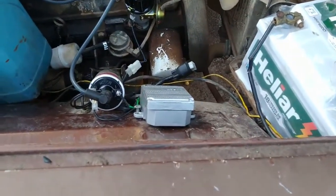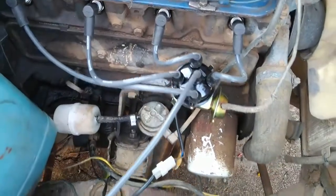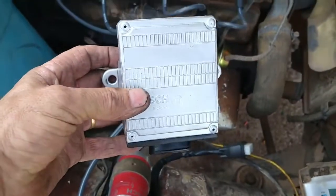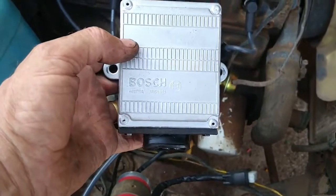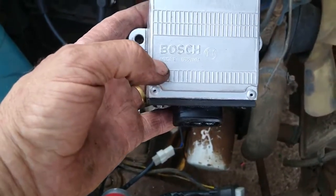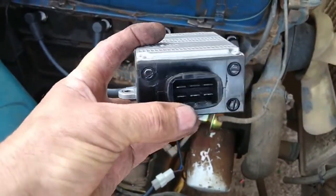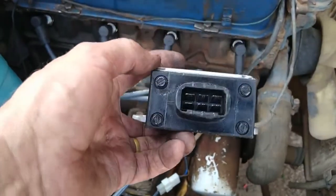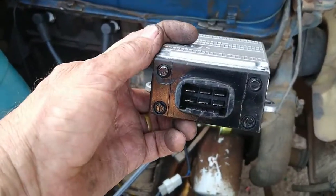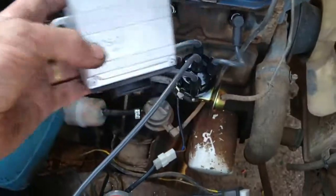Another stage almost completed — it wasn't fully completed due to one detail I'll show now. All the electronic ignition equipment here is new, except this module. The original manufacturer no longer makes it, and you can see it's riveted, indicating it was reconditioned. An important alert for anyone installing this: they painted this part here and also painted the connectors and terminals. You have to clean all the terminals before installing, otherwise you'll get poor contact and a series of problems. I'll do this cleaning, finish mounting, and then show it working.